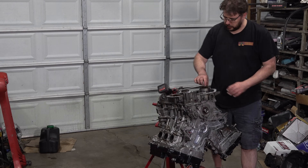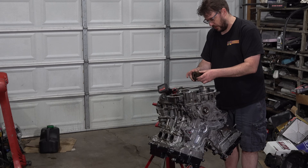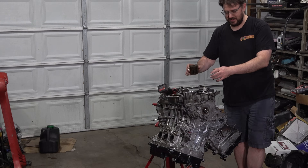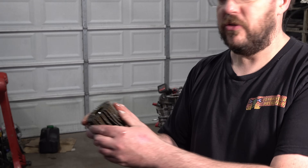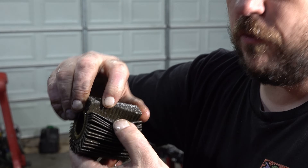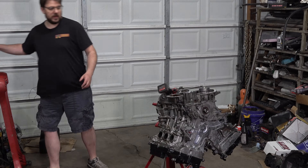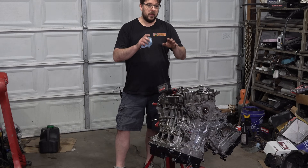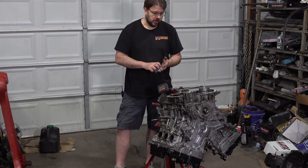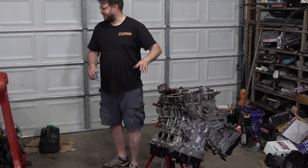The oil filter should give us our first clue. If this thing was catastrophic, the oil filter will not contain much debris. But if it worked its way to failure, this is what you'll see. These things are absolutely chock full of bearing material. That's telling us there was bearing material failure before the ultimate failure — because it had to be able to get pumped through the engine. So that does support that there was probably a spun bearing, but there'll be more evidence if we get there.